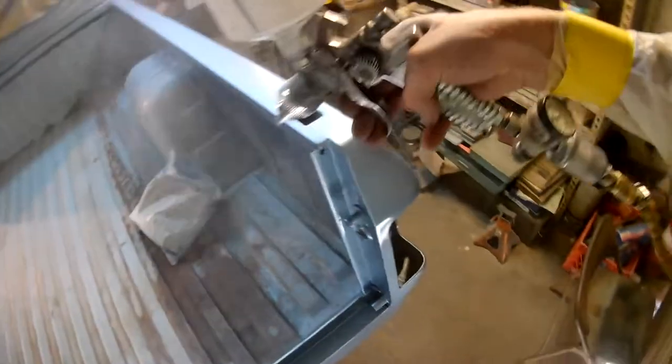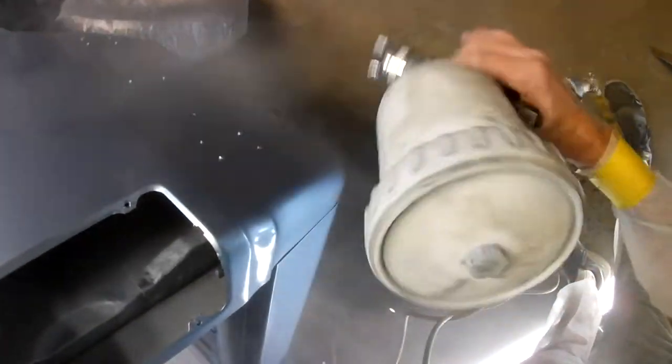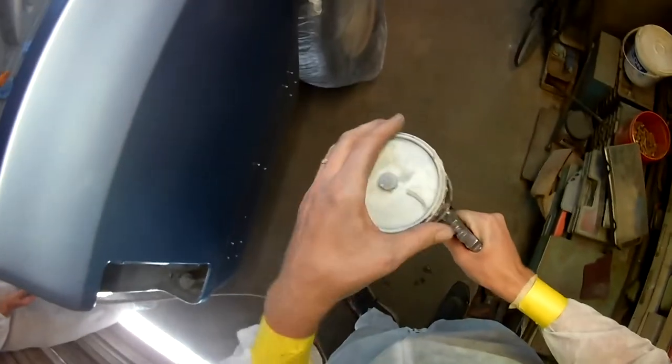And I also wanted to mention, we used just under a gallon of clear on the truck in those three coats. I think I may have a little over a pint left, unmixed, in case I need to do any touch-up work or whatever. Quick check here to see how much is left of my gun, but right side of the bed.